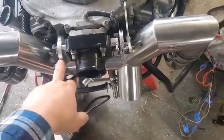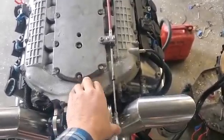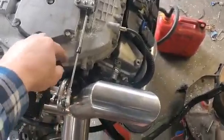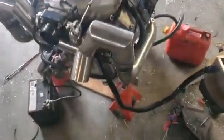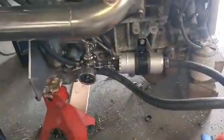Mechanical throttle body — hook the cable up there. There's my bracket on the intake manifold, so it's just a standard 33C Morse cable. Got a MAP sensor there — it's a Delphi one-bar off an LS Chev, they're good. Got my fuel pump down there and my regulator.